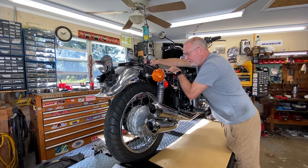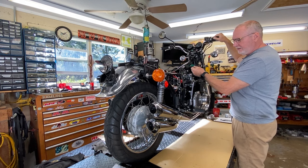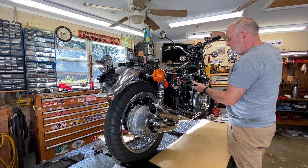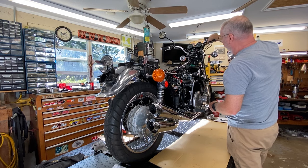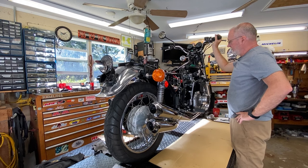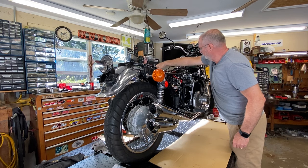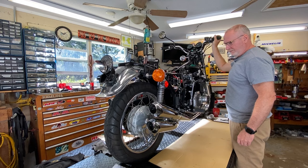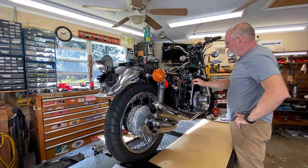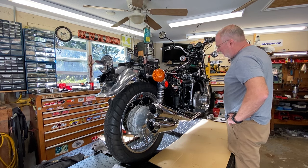When you lift the enricher lever, if you go full it doesn't want to start at all, but if you just crack it a little bit it fires right up and the idle actually comes up where it's supposed to be — which is kind of interesting because that's a fixed thing. Let her warm up a bit. There it goes — better now. Very cold-blooded, this one.